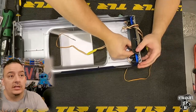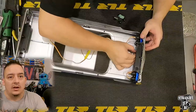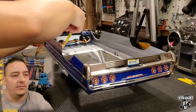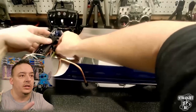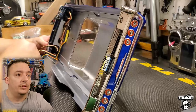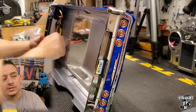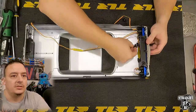I was trying to think of ways to get the light wiring nice and tucked, so I decided to go with tucking all the wiring into the front grill. Quite frankly, the only other option I was thinking about was zip tying everything underneath the front body mount, but I didn't really want to do that. So I decided to make it look as clean as possible. With these wire holders, it was a great opportunity — all I had to do was wrap the wires into the wire harness holders and it ended up looking pretty clean. I staggered the wire holders on the front end so they'd keep the wires away from everything tucked underneath the body. Just take the body off, unclip three clips, and you're good to go.